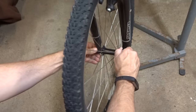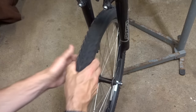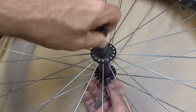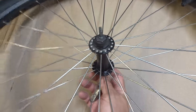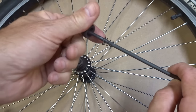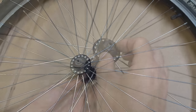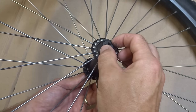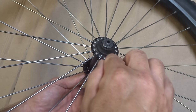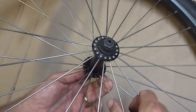Let's go ahead and remove the wheel and get started. Remove the skewer here, unscrew this, pull this little spring off, pull the skewer out through the back, and I'm gonna slide the spring on there just to keep it all together and put this to the side. This stuff's loose here — I'm unscrewing this lock nut by hand, so it was loose. The cones are totally out of adjustment, so I'm gonna open this up and overhaul this whole hub.